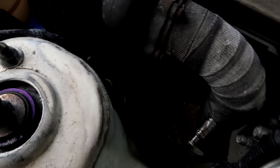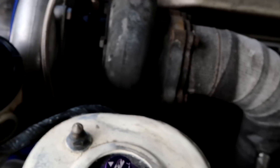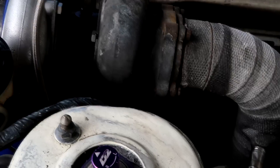It seems to have a big crack in the manifold and there's been heat wrap used on it just to try and stop the exhaust leak. It's got some number eight wire there - we'll whack that off, take the heat wrap off and see where it's cracked and try to weld it up. Just eliminating the basic stuff.